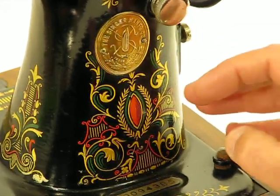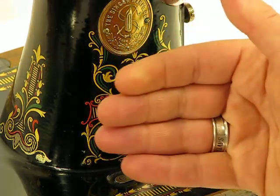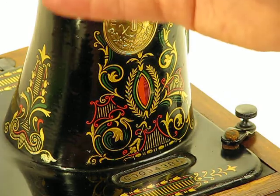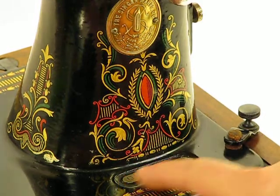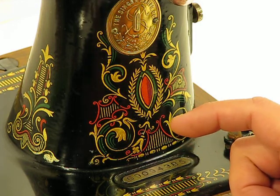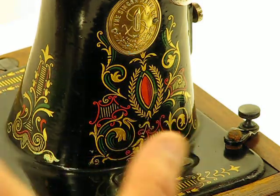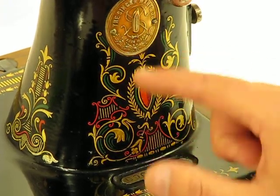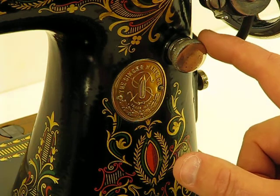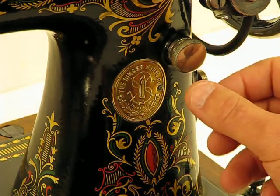The faceplate is equally spectacular. On the right side of the machine, to service the bottom you would loosen this fixture over here that holds the base in place and then carefully rotate the machine up for oiling purposes. We have our serial number — this particular machine was born on December 6th, 1921, making it about 91 or 92 years old, almost 100 years old. You can see the traditional red-eye pattern and the gorgeous Singer trademark emblem right here. To the right of it, we've got our stitch controller. The further you turn it clockwise, the longer those stitches become.